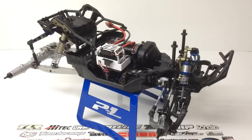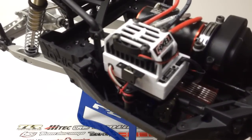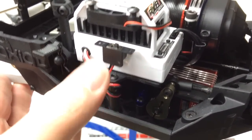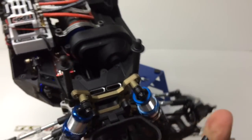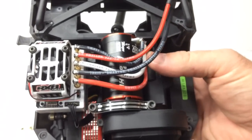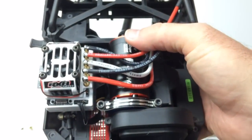If you need any tips on how to solder an RX-8 or a Pro 4 HD, I will have a link in the video description to an old video I did about a year ago covering how to solder those two items — some cool tips and tricks that will definitely help with your RX-8 installation. You'll see right here the RX-8 sits perfectly on that little plate supplied in the parts bag. I have some wires wrapped to take out excess slack, and double-side taped the switch to the side of the ESC. On the flip side, I'll show you the motor turned to about 2 o'clock, which allows the motor wires to have a better bend to them.